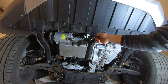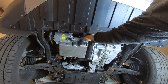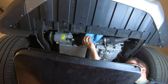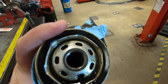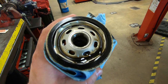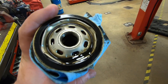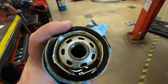It's best to turn the oil filter a little bit, let it drain out, then go ahead and grab a rag and continue to pull the oil filter all the way out. Now when you take the oil filter off, there's going to be a black seal on there. You want to make sure it's stuck on the old filter. If not, that means it's stuck up on the motor and it needs to get taken off before you put the new filter on. The new filter is going to have a new seal on there. If the two seals go together, all the oil you put inside that motor will fall out from between those seals when you start the engine.